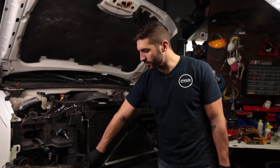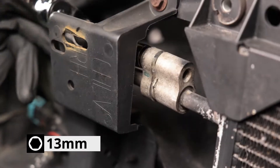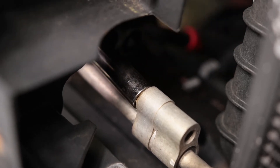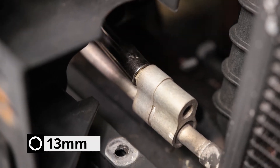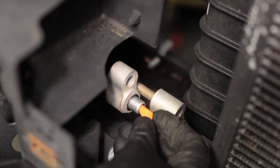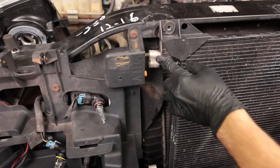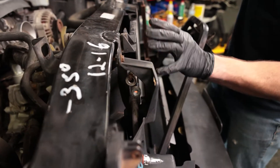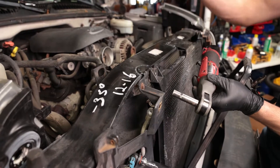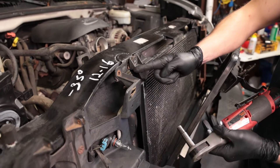Now you're going to disconnect these lines. This is the top refrigerant hose — just use a deep 13 millimeter socket to break it loose. Top line disconnected. Now remove the bottom one — you can actually get to this from under the wheel well, same 13 millimeter. I'm going to stick an ear plug in there and let it expand to block off the port. This stud is supposed to come out with an E-Torx bit but unfortunately the head is rounding off and it's holding me up from getting the condenser out. So I'm going to take this 10 millimeter bolt out and make a gap and try to get the condenser out that way. If this doesn't work I'll probably just cut the stud, because the new condenser does come with new studs and nuts.